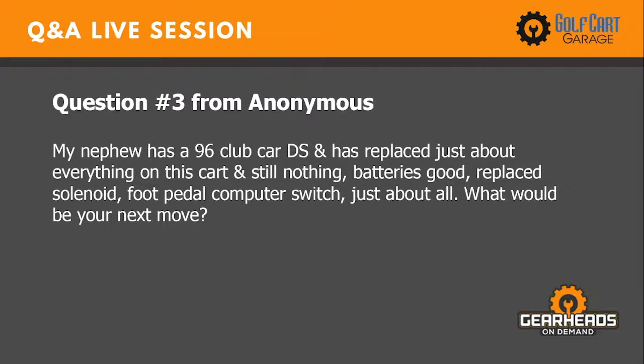Number 3. My nephew has a '96 Club Car DS and has replaced just about everything on this cart and still nothing. Battery's good, replaced solenoid, foot pedal, computer switch, just about all. What would be your next move?